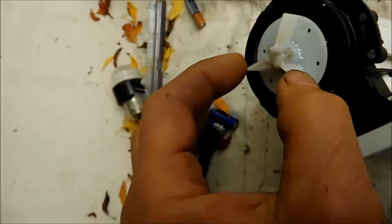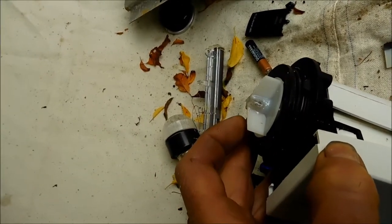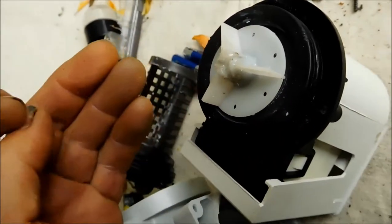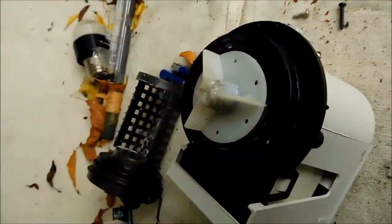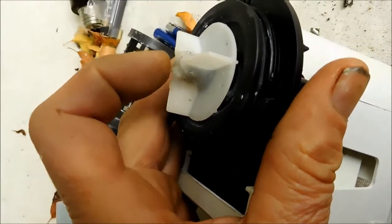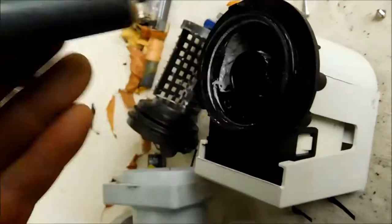What I've done to repair this — you can see I've cut it. I use a soldering gun to make little cuts in that impeller. What I've done before is take a hacksaw and hacksaw kind of a Y in it. Be careful not to scar this housing because this housing has to seat up against there. Then I put some E6000 glue — or you could probably use automotive goop — and that has held onto the armature shaft. So now this pump is repaired.